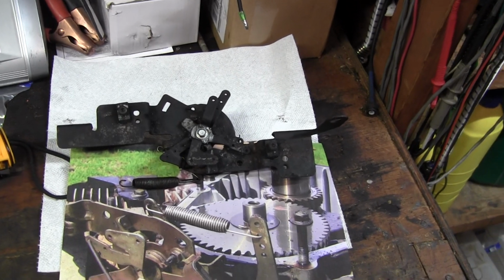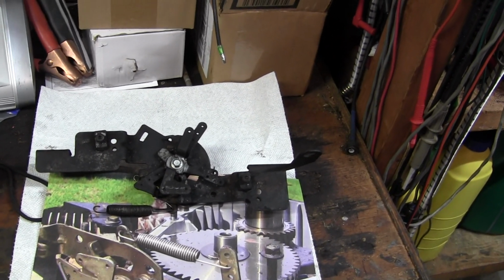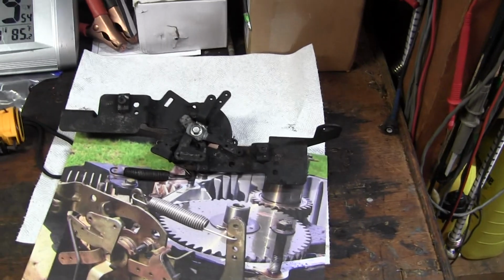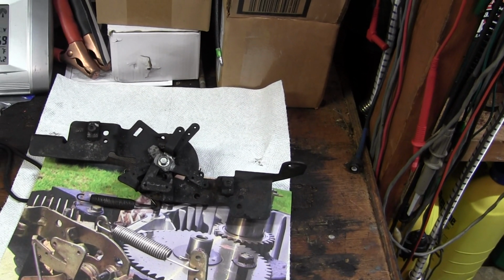It also has magnets that come loose on the flywheel and destroy the stator coil. My engine doesn't have that problem. Mine kept popping the lower seal. Now, the lower seal can also pop if you have excessive wear on the rings.